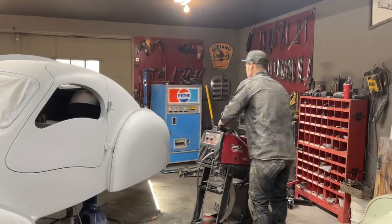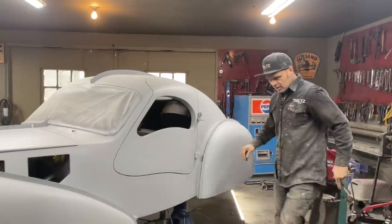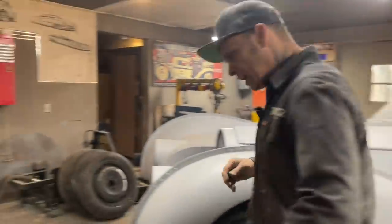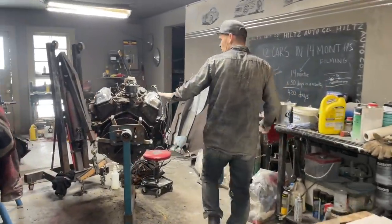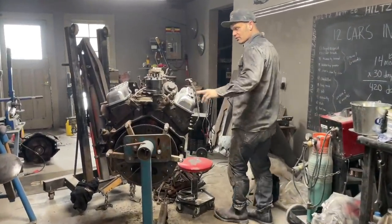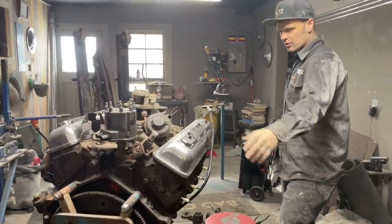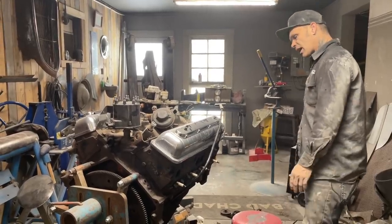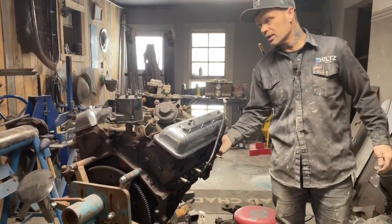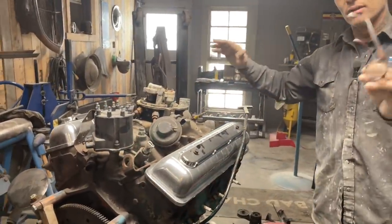We've got a nice wintry day out there. Also, I got a couple other things I want to do. I don't know if Jolene showed you the other day, but I got the 305 stripped down, and I tried the valve covers on. They're cool. I'm going to get a starter and check out the compression in each cylinder, see if it's okay. I think I need a frost plug. When this dome comes off and we change the other dome, we'll paint it green.